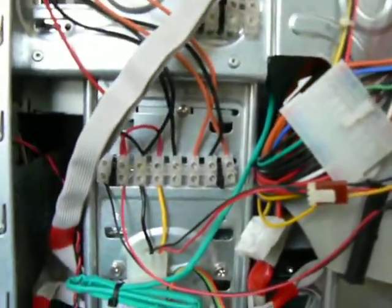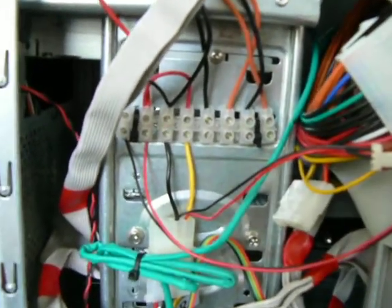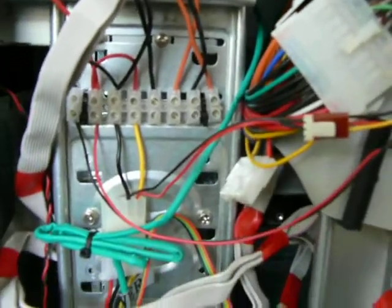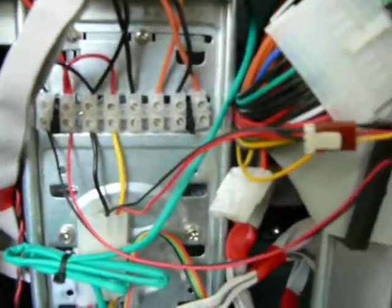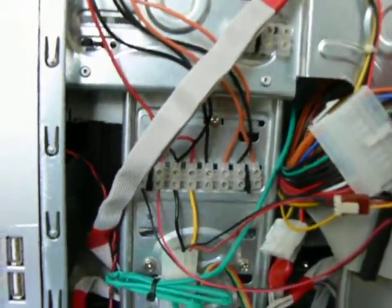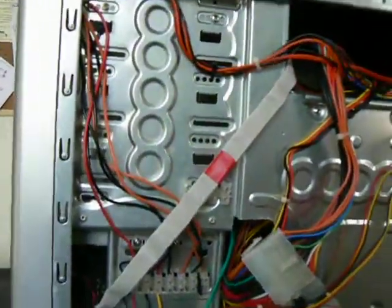The 3.3 volt rail is quite useful on a computer — not used a lot, really. It occurred to me that with a newer power supply, if you still want to do the same thing, you can achieve it using one of the SATA power cables. SATA power cables do have a 3.3 volt rail in the spec, even though no current SATA hardware uses it. Note that a molex-to-SATA adapter won't have it, but a proper dedicated SATA cable will.